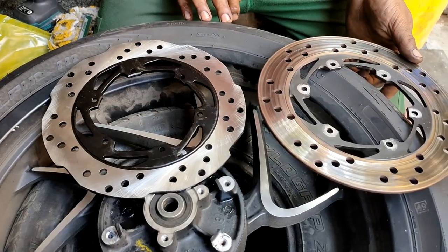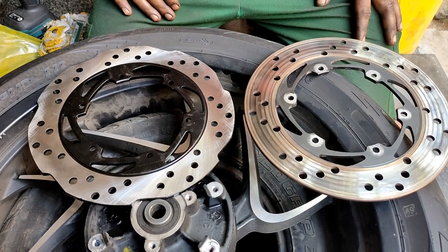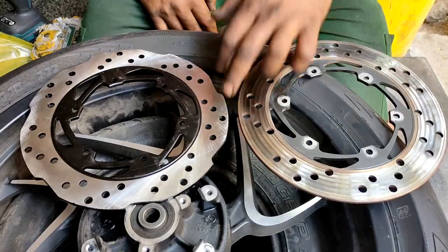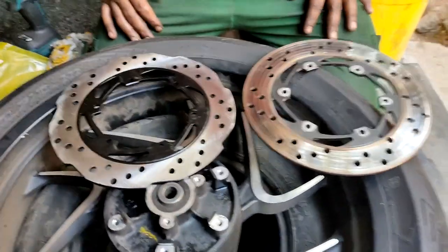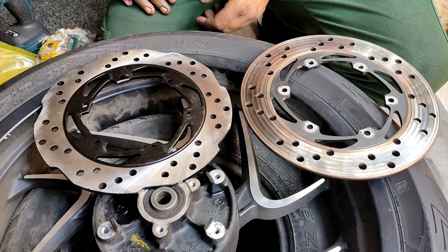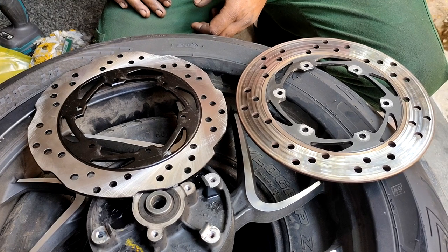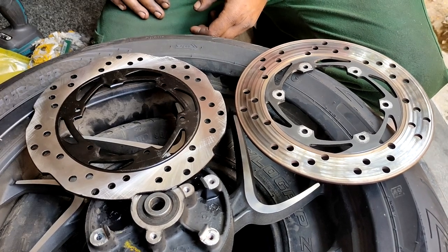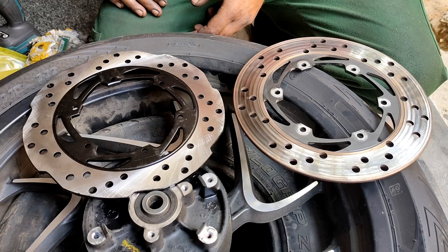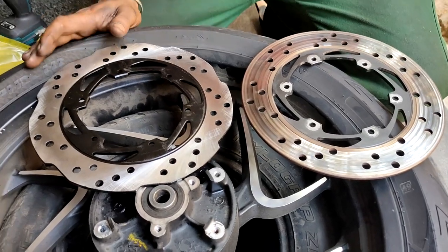For those who don't know what the holes are about — the air circulation through the holes cools down the disc. Additionally, older solid discs with no holes had a risk that under extreme heavy braking, an invisible layer could form between your pad and the disc, causing a complete loss of friction and braking. So these holes are very, very important.